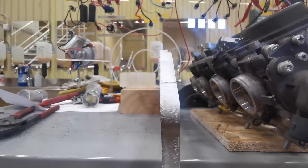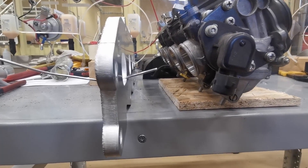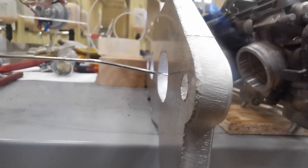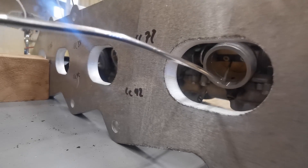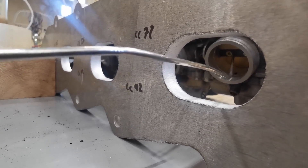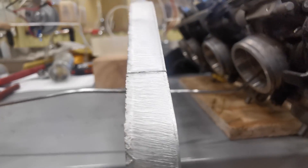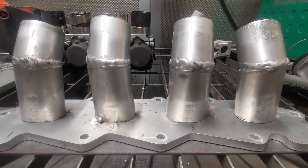Now there are probably loads of ways of doing all of this, but I'm old school. So what I'm using is a piece of aluminium TIG wire — I can put that in the middle of the carburettor and then adjust it so that it comes out in the middle of the opening of the hole here. As you can see there, that now gives me all the angles that I need. So all the pipes are cut now.